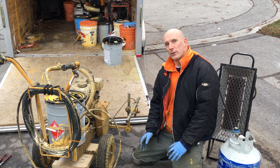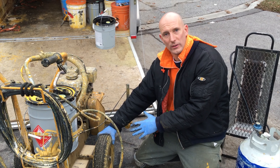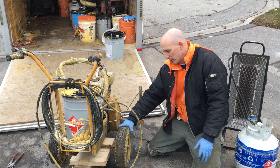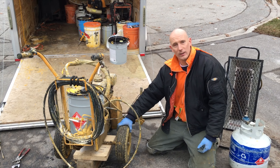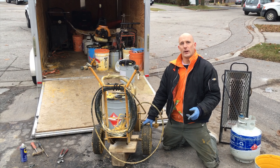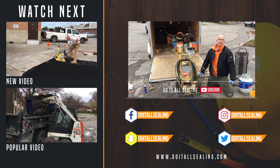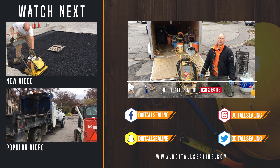Now we just have to do the other wheel. As I mentioned, this is why you have to change the bearings — look at all the play on this wheel; the whole thing is shifting and the bearings are completely gone. I wanted to show you why you actually have to replace the inner and outer bearings. You've already seen me do one wheel, so I'll go ahead and continue with this one. Hopefully this video helps you whether it's a line painter, a lawnmower, or any application — just make sure you have the proper bearings for your application. Thanks for watching, drop a comment below, hit the like button, turn on notifications, and don't forget to subscribe. We'll see you next time at DoItAllSealing.com — take care guys, bye.